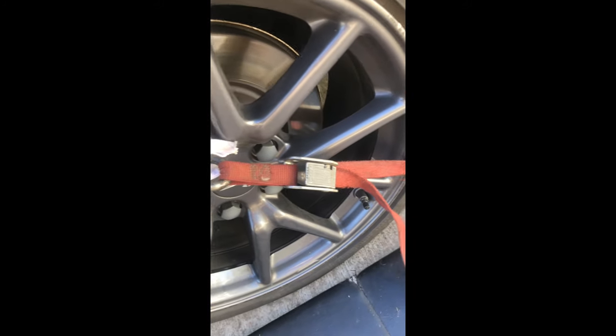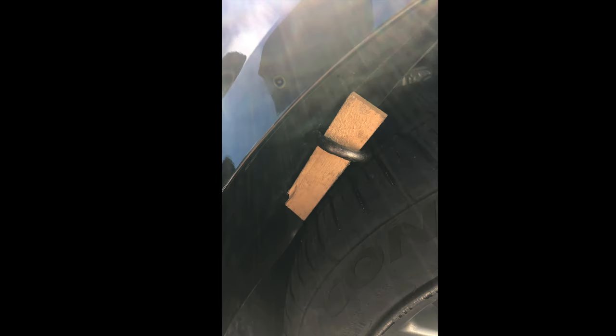I put my strap around the tire to keep the plastic wheel liner out so I can get tools up inside and start work, because essentially all we need most of the time is pressure behind the damage. Here I'm showing in this Tesla right front fender that there are no dangerous wires in the way — it's just a simple 12-volt system you're normally working around, and it's wide open. These cars are fantastic for access and the paint is amazing, so I'm ready to get started.